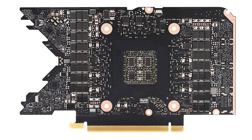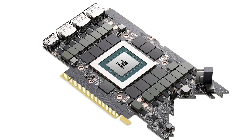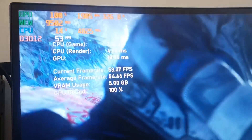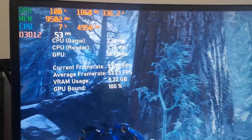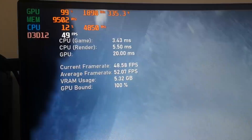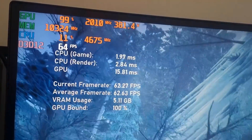The Founders Edition card has a boost clock of 1665MHz. But just like any modern GPU, that's typically a very conservative figure. Assuming the ventilation of your case and other conditions allow it, the card will typically boost at much higher frequencies. For me, with the card running at stock, it would generally boost to mid-1800MHz to 1920MHz. This would put the card at 330 watts, which is exactly what NVIDIA stated. So, depending on conditions, the card would boost from mid-1800MHz to 1920MHz and generally sit at 330 watts or slightly higher TDP.